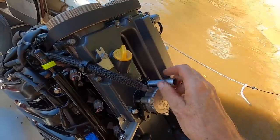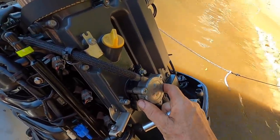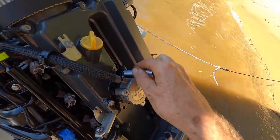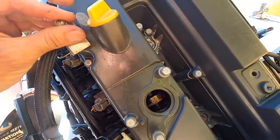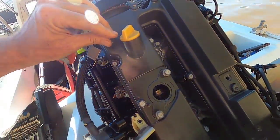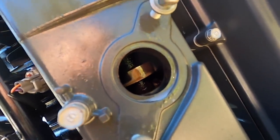Any part I can't do that I'll put into a ziplock bag, but I always prefer that system. You can see here this pump's lifting up — it was obviously under pressure on the camshaft. That lobe was obviously up lifting it. Looks like there's a bit of rust on the cam from the water and the oil. Bit of damage done by the moisture already. That's the lobe that drives the fuel pump.